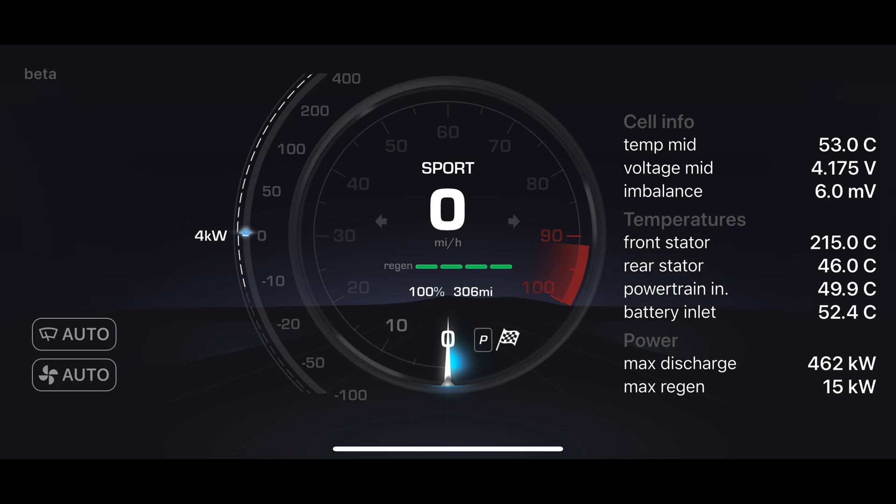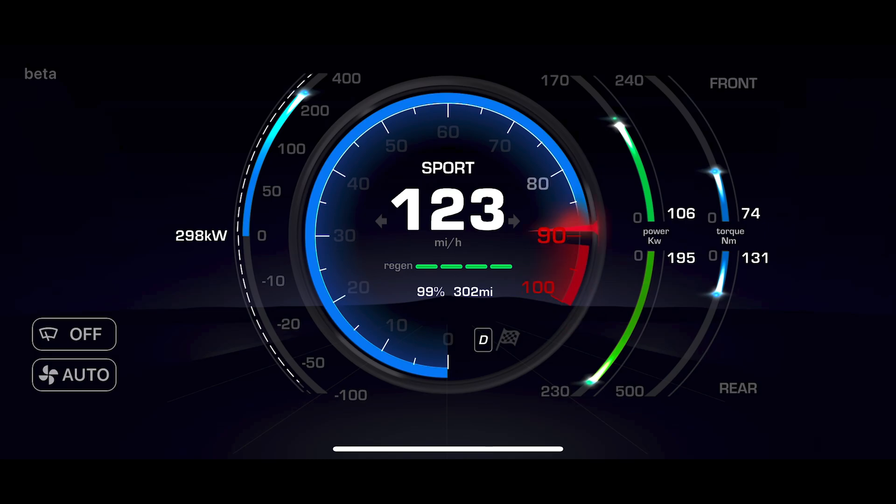Please note that 462 kilowatts does not indicate the maximum power that the car can produce — 462 kilowatts would be 628 horsepower, and the car can't produce that much. It probably produces close to 500 horsepower at the wheels. If the max discharge rate drops to 452 kilowatts, battery percentage drops below 95%, or the battery inlet temperature drops to 45°C, then performance drops off slightly. As you go further below those values, performance will degrade even more.